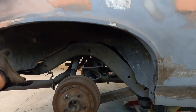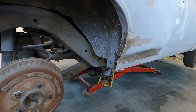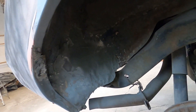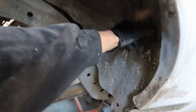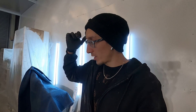Luckily, with my handy screwdriver I caught it, so I've got a bunch of welding to do. I need to figure out the fender walls and weld all this up, reweld it, maybe cut out a new sheet. There's also bondo here that needs to be cleaned up, and the whole bay needs to be cleaned out. Before I continue body work, I need to make sure everything's welded up.